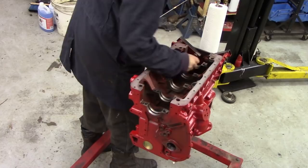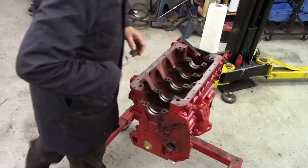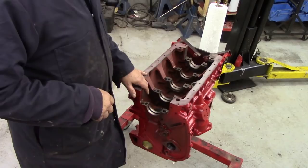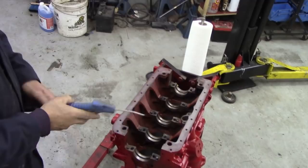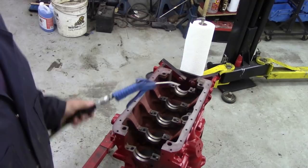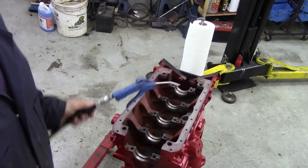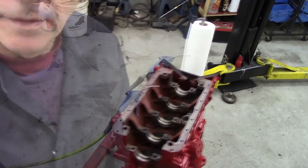We'll take that off and then we're going to do the same with the caps as well — the bearing caps. The crank's already been cleaned, so really all we've got to do is clean this out with a bit of brake cleaner, and then we're sort of good to go. We make sure all the threads are dry and there's no dust, oil, or any contaminants at the bottom of the thread holes. That's really important. So that's nice and dry — that's ready to go.